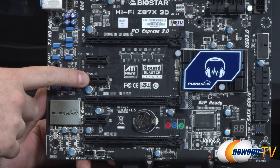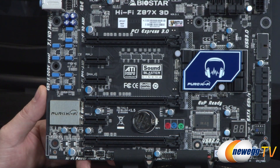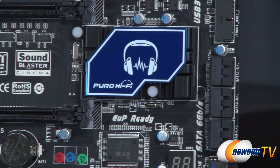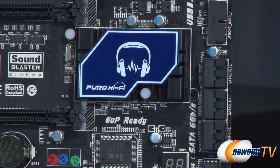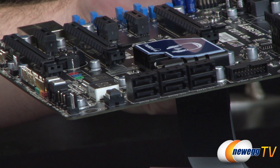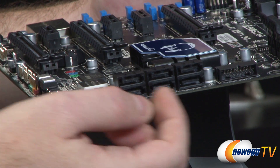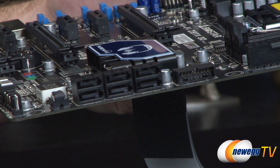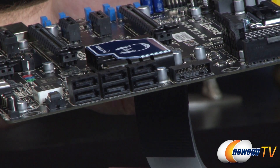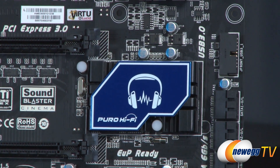There are also some PCI Express Gen 2 slots — three X1 slots and another PCI Express Gen 2 X4 slot at the bottom coming off the chipset. The Z87 chipset is located right underneath the heat sink there. One of the really cool features of Z87 is a full complement of six SATA Revision 3 six-gigabits-per-second ports for your SSDs, hard drives, and any other drives you might connect. You also have a 90-degree right-angled USB 3.0 header, which is a native USB 3.0 connection point that'll give you one or two front panel USB 3.0 ports.